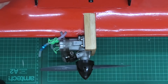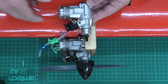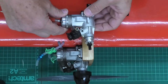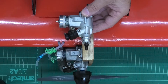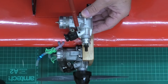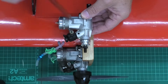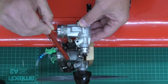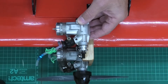Here we have the Mark 2. Essentially, if I just slide this forward, the Mark 2 was more or less identical to the Mark 1. The only difference is that the crankcase intake spigot on the carb was larger on the Mark 2. Hopefully you can see there's a bit of a size difference — the spigot was increased by about one and a half millimetres.